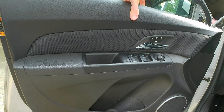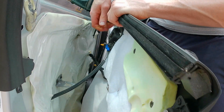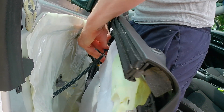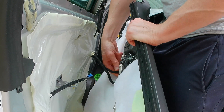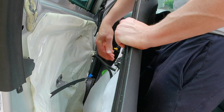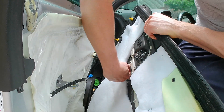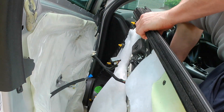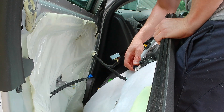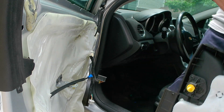Once it's all free, lift the door panel up and over the door handle. Close the door and reposition. You'll see the door handle control — there's a little tab you pull up, slide the blue plastic piece out, and the ball knob comes up and out of the handle. Then you have two plugs — just pinch and pull them out. The one for the door locks has a lock on it and you'll probably need a screwdriver to pop the lock back so you can pinch it. Once that's out, take your door panel and set it to the side.